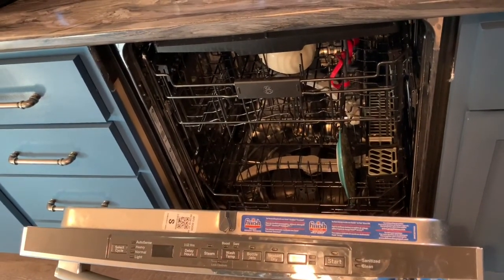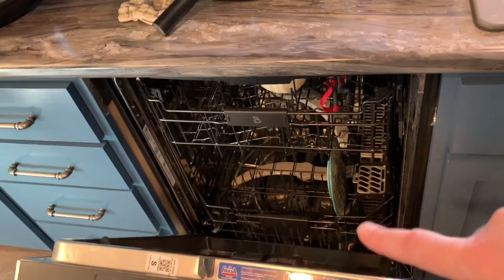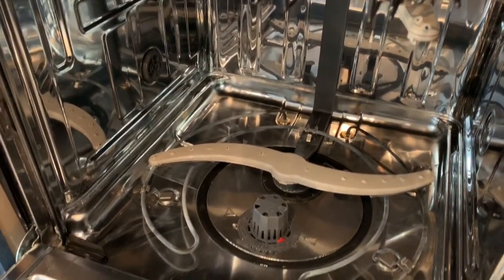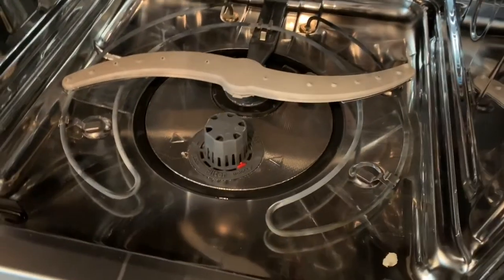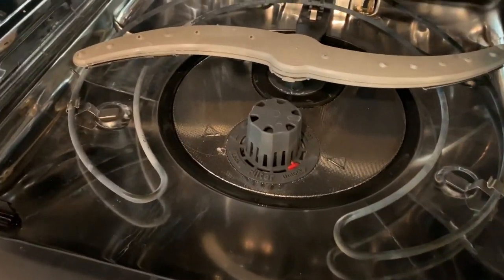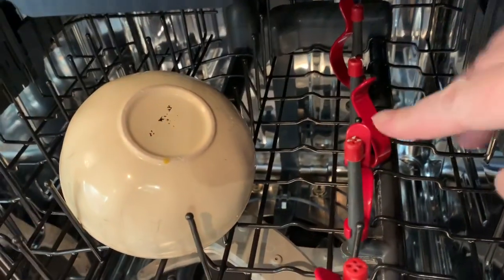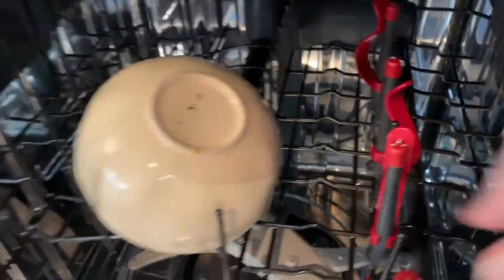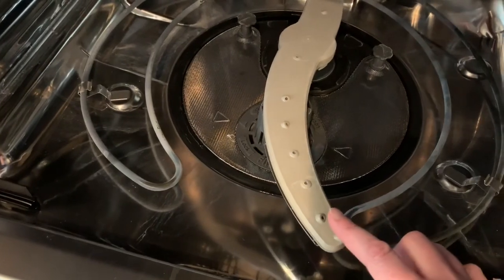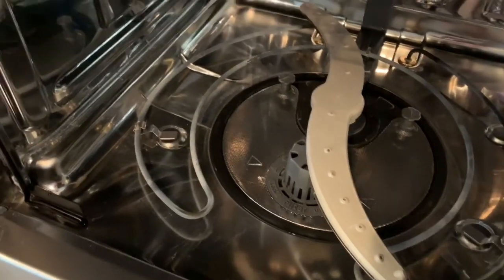Now that we've run through all of that, for those of you waiting for the maintenance tips — hang on two more seconds. I'm going to pull that bottom rack out and show you how to work in the bottom of your dishwasher. Here's what the inside bottom looks like. First of all, this is your heating element — this is what heats up for the dry. I do believe it also helps heat the water at certain times but don't quote me on that. Now I showed you the jets up here that I need to clean out — they've obviously gotten clogged. You need to be checking your sprayers to make sure that none of the jets are corroded, plugged, or anything like that. It is really important to keep those clean; otherwise your dishes are not going to get cleaned properly.